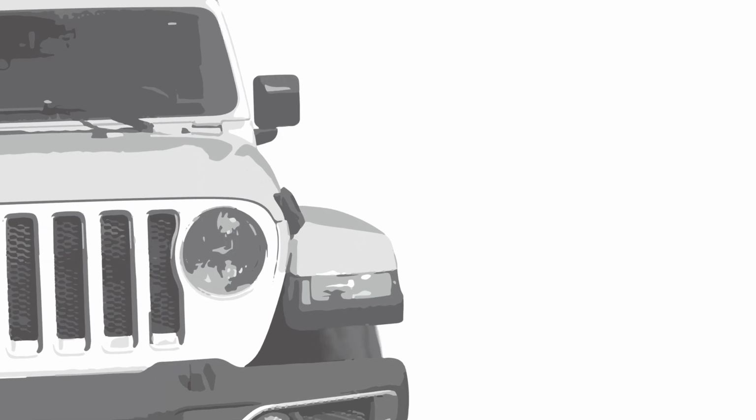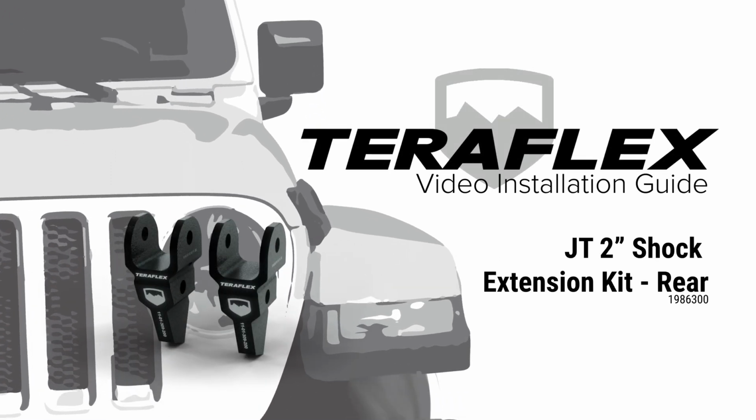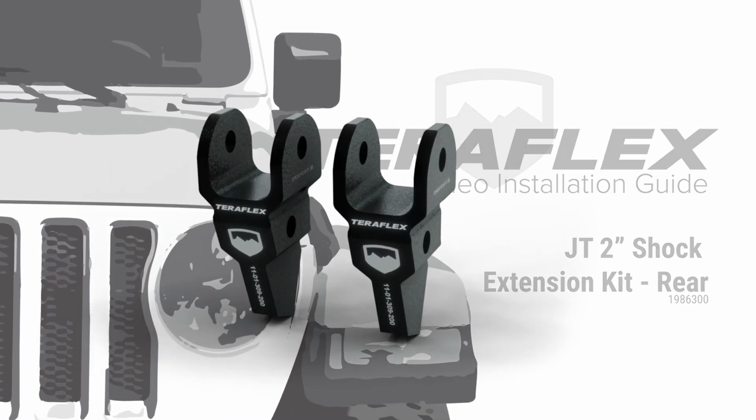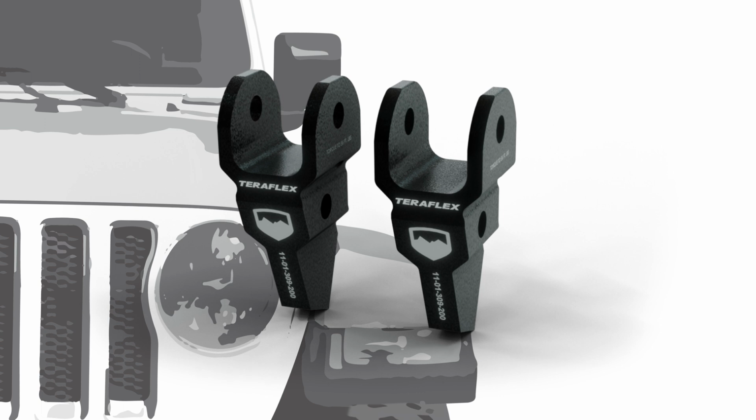TeraFlex's rear shock extensions for the JT Gladiator change the mounting locations of the lower shock mounts. This allows you to use the factory shocks with a small lift. TeraFlex shock extensions do not increase the amount of travel offered by the shocks to which you attach them.